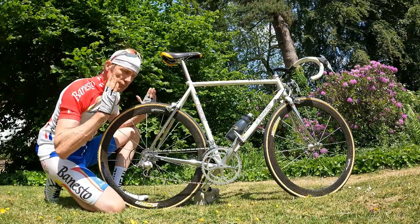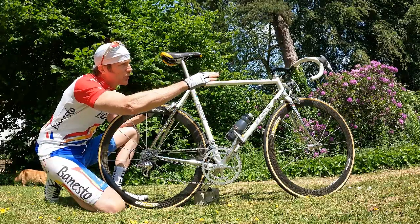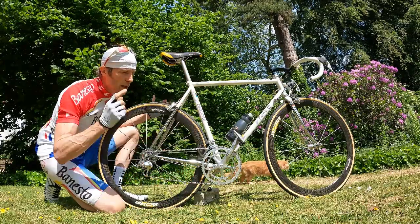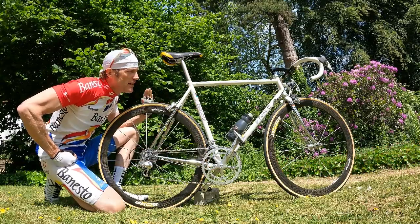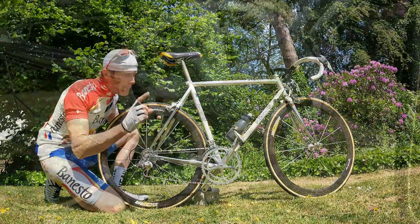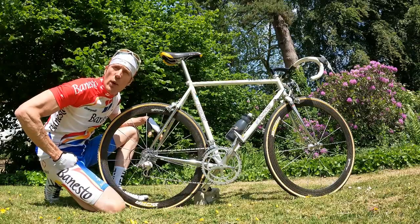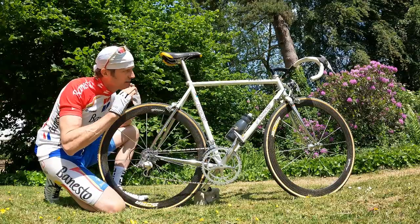We did meet this bike — I did a little setup on it a few months ago. I had to change the stem because it was a bit short, and I also changed the tires, but other than that it's exactly as it came. Groupset-wise, it's Campagnolo Record Titanium nine-speed throughout — utterly superb groupset, my personal favourite. It's got 53/42 up front and I think a generous 11-25 on the back, so quite rideable. 26 or 28 would be nicer, but this is very rideable.